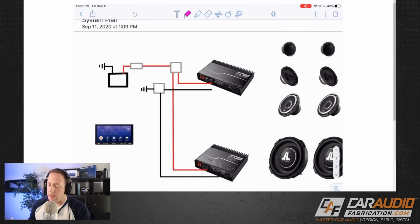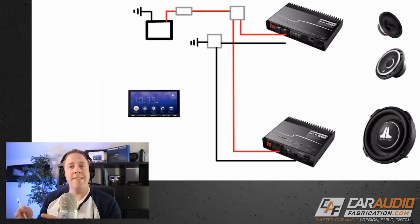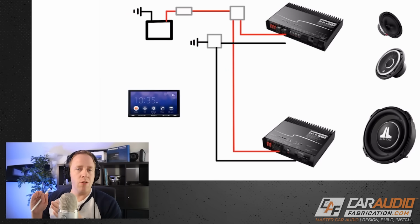Now we also know that we need to have 2 ground wires, obviously each attached to our amplifiers. So I've drawn those in, and those will have a distribution block as well. And that distribution block will be grounded. That's what that little symbol there means. That means it's connected to the frame or ground of the vehicle, which is also what the battery is connected to on its negative post. Now don't forget that at this phase, we're not worried about any of the specifics. We're just drawing in general connections.